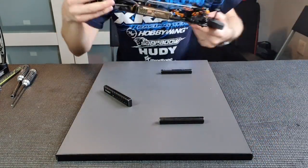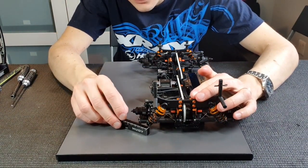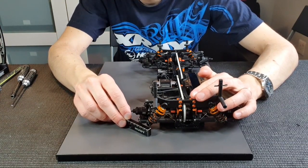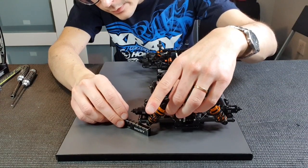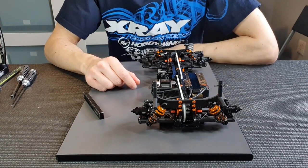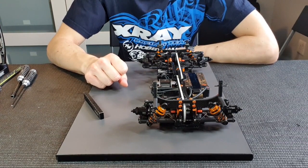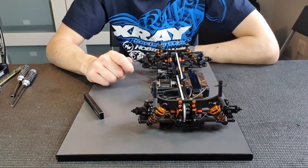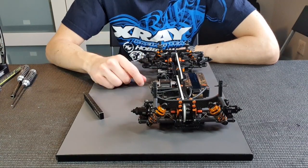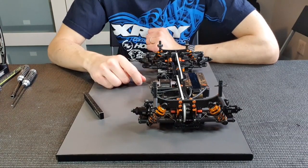We measure from the front of the front arm and from the rear of the rear arm, regardless of any dive or squat setting in the suspension. We always do the same way — from the front of the front and from the rear of the rear. We always measure the downstop with the shocks attached. This is the team standard. We feel that this is the most accurate and consistent way to measure the downstop, and the values in our setup sheets reflect that.